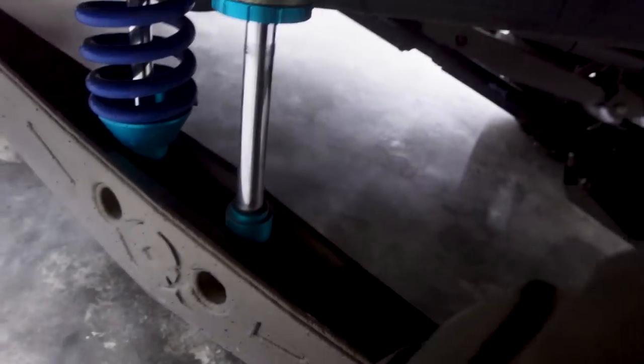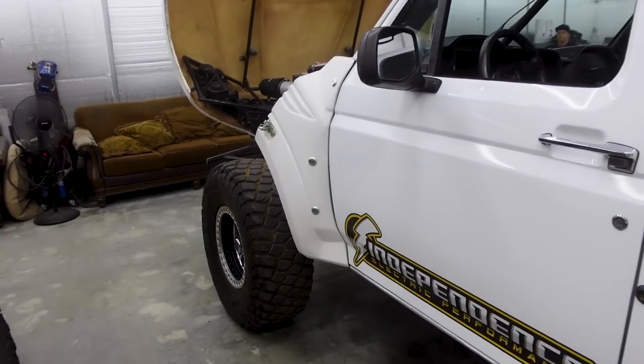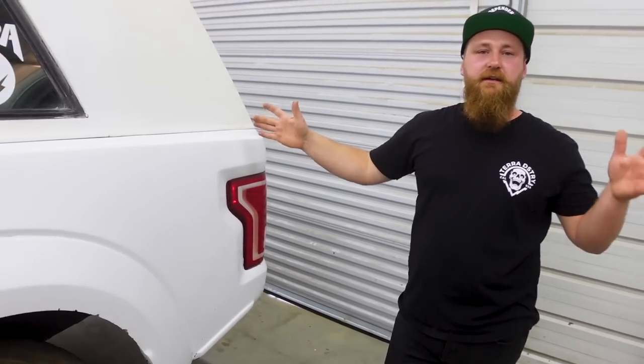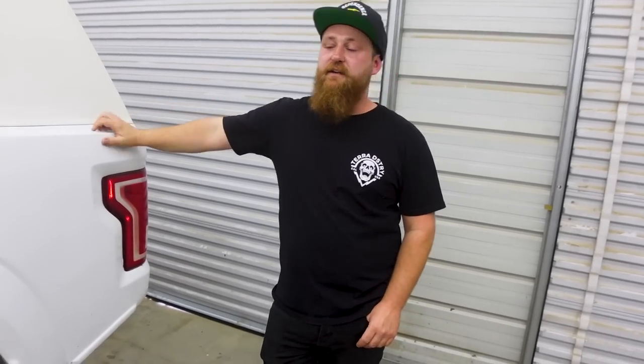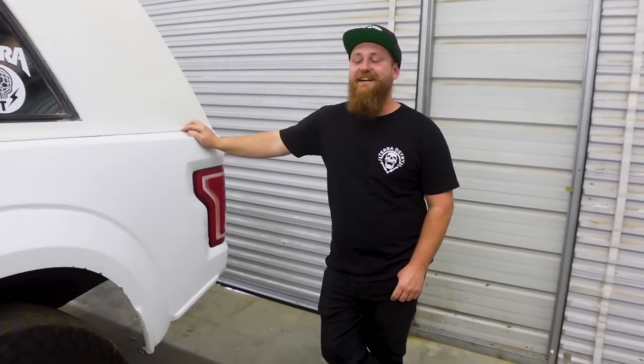What's the shock package back here? A 2.5 coilover, 2.5 bumps, 3.0 bypass — actually 3.2. Again, tuned 10 times by me and my friends. One day I'll get it tuned professionally and I'm sure it'll work better, but it does good. Looks like you've got a lot of up-travel too. What are the travel numbers? Front is strapped at 19 inches and the back is strapped at about 29. With the Chevy motor and transmission being shorter, we could actually pull a little more — Ford is longer so the driveshaft is shorter and you have to strap it tighter to avoid too much driveshaft plunge.